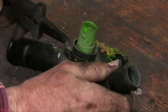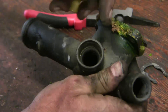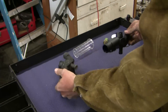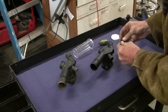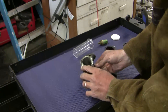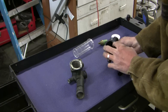We'll pull this clip out, and then the coolant temp sensor comes right out. There's a little o-ring in there I'll have to replace. Here's our new coolant flange — it seems to be identical to the previous one. I asked them to give me a new o-ring for the engine coolant temp sensor because the previous o-ring was messed up. This is a little thicker than my generic o-rings that I have in stock. I'm going to put it all back together again and put the coolant temp sensor in place.